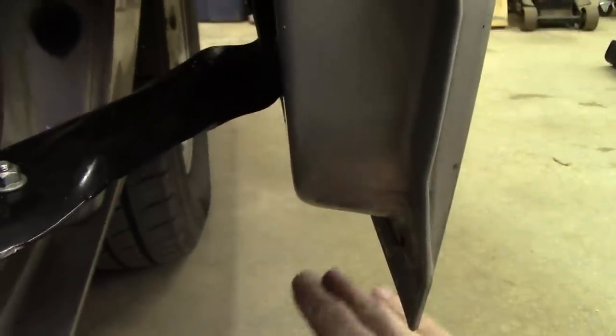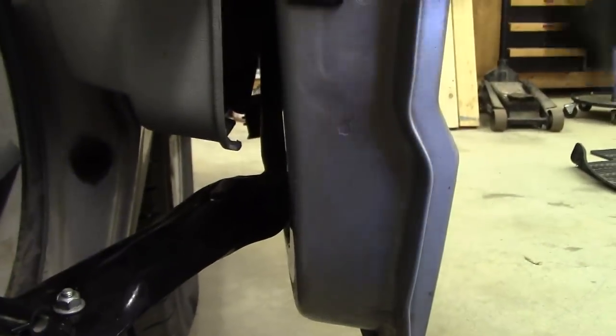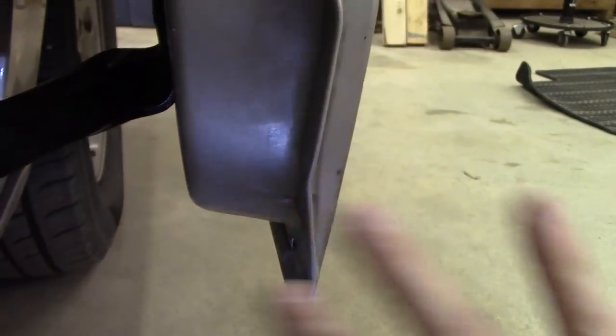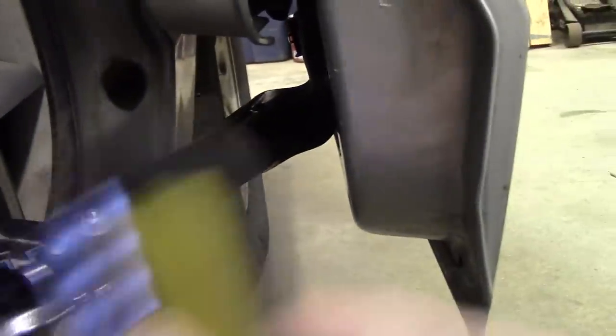So let me go ahead and pull those off. Once I do that, this door is going to want to fall. So I have a milk crate that I can stick underneath here to take the load off. Once that happens, you just have to be careful. There are mounting points up there, so it's not completely relying on what you're putting underneath, but try not to bump it while you're removing the rest of this assembly, so it doesn't cause trouble for you.